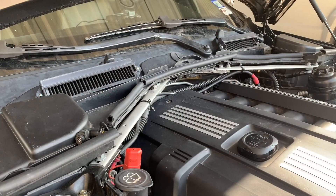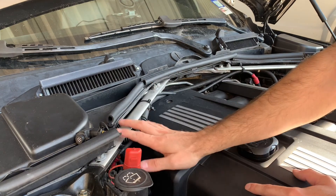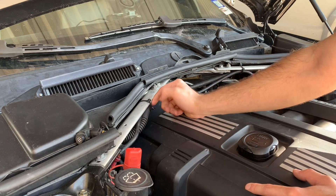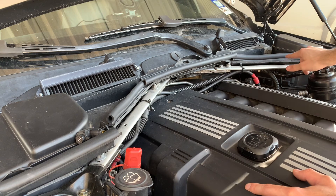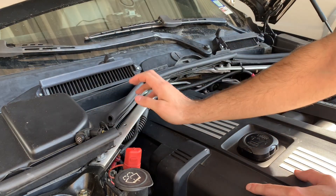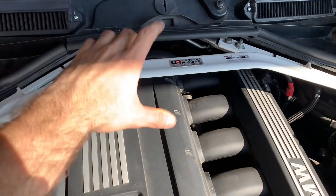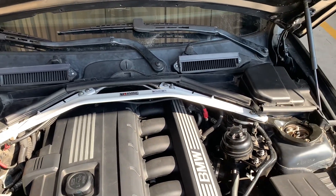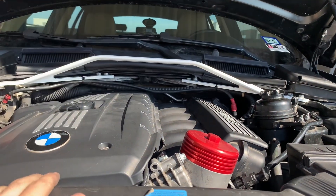I decided to work on the big piece first. It's pretty simple and plug and play — only eight bolts and you're good to go, but you must have an M3 strut bar mount to do this. I also have to take off these zip ties and I'm modifying the cowl right here too, which helps take it on and off and looks cleaner. If you don't have a modified cowl, you'll need to remove the cowl entirely to access the M3 strut bar.